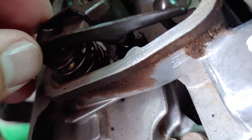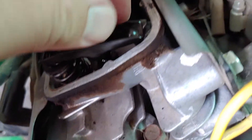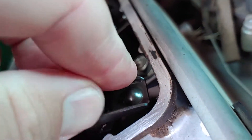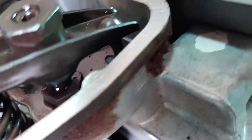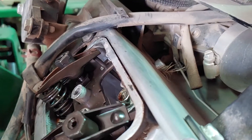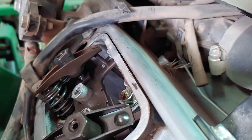So now you can set your clearance down here. If it's real loose like mine was from just putting it back together, make sure your pushrod is in that little dimple on the top. I've been putting the three thousandths feeler gauge under it.